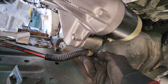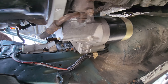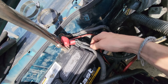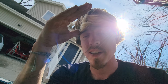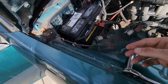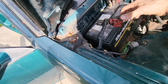I'm going to go ahead and attach the starter wire to the starter — this is a KA starter wire, so hopefully it even fits on here. It's so close to the firewall. The nice thing is there's no exhaust manifold in the way like there would be if this was a VG. It was my mistake not to bring a negative terminal, so we ended up finding an old Integra positive harness — it's red but it's on the negative, so it is negative. We also have a red ground wire going from the firewall to the engine, and the terminal from the battery goes directly to the firewall. There was one power wire coming up from the mini fuse box area, so I attached that to the KA positive terminal.